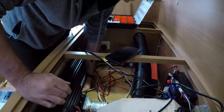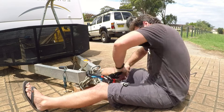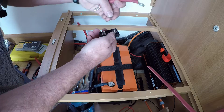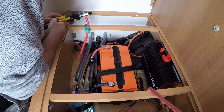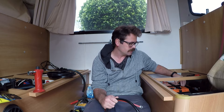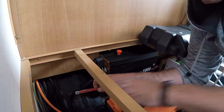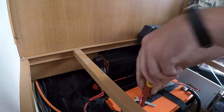It's close to a 240 power point and also close to the other services I'm going to be running to the Redarc unit — like the solar input, DC input — and it's also within the one-and-a-half metre that Redarc recommend from my battery. Over on the other side, under this side of the club lounge, I have my iTech World 120 amp hour lithium battery. That battery is the same size as a normal AGM of 105 to 120 amp hour capacity, so it sits nicely as a drop-in replacement. Behind that, I've got the 1000-watt iTech World pure sine wave inverter screwed to the wall nice and close to the battery so the cable runs are short, because these do draw some big power.